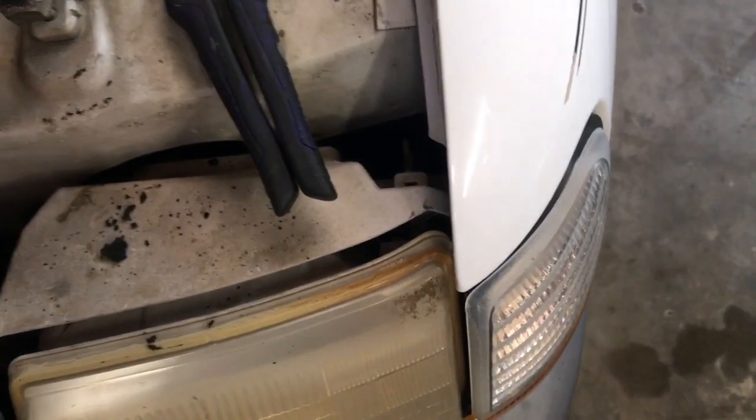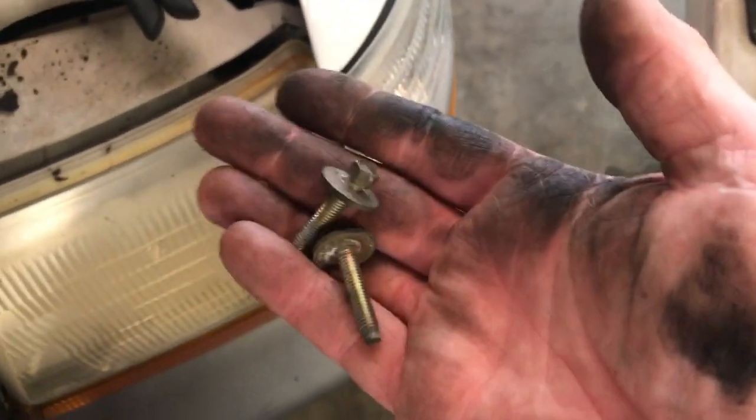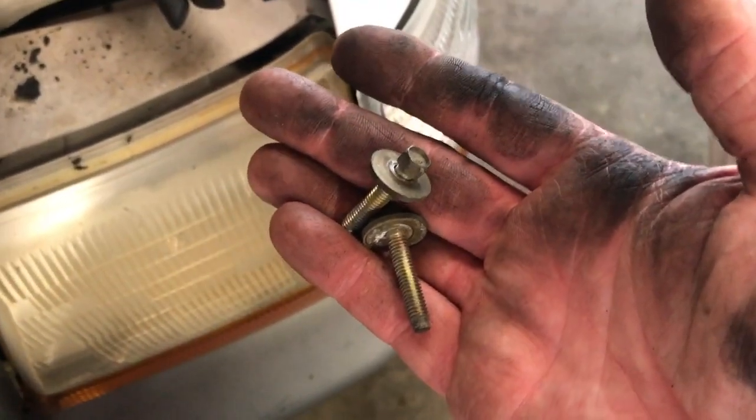And to get that pipe out, it's kind of hard for me to show you this, but down here on the bottom side of the alternator, okay, you don't have to remove the alternator. You can actually reach in there with a 1/4-inch drive ratchet, and what you're going to remove is these 2 bolts right here. I'm going to show them to you. They got 8mm heads on them, and you'll remove both of them.